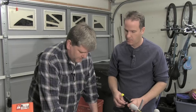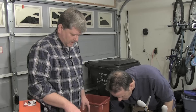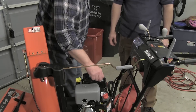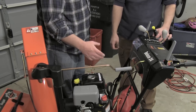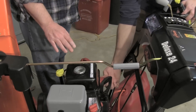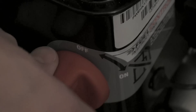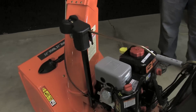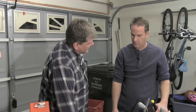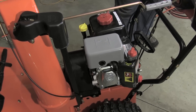The third option is kind of an in-between option. You'll always want to use fuel stabilizer with this, but what you can do is — if you have a little bit of gas in there — start the snowblower up and then turn the fuel supply off while it's running and let it stall. Get the engine going and then shut off the fuel supply. It'll run for another minute or two and then it will stall. So then you only have fuel in the tank and a little bit in the fuel line, but no fuel in the carburetor where it does the most damage. And obviously you want to make sure your garage door is open — you don't want fumes in your garage. Take it outside and let it run.